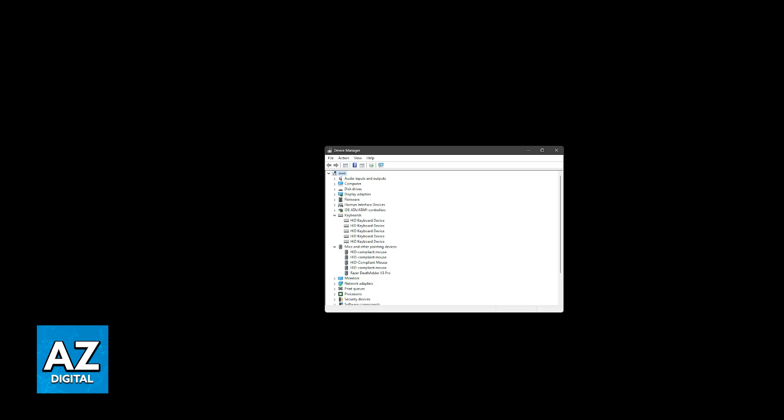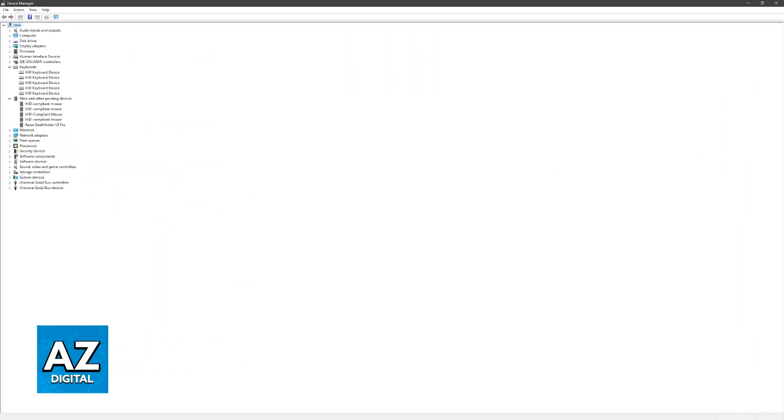The last thing you can try is to enable legacy USB support in the BIOS. In some cases, a setting change in the BIOS might be necessary. To try this, restart your computer and during the startup process — where you see a logo on screen with a blacked-out background — press the key designated to enter the BIOS. This is usually Delete, F2, F10, or Escape. When in doubt, try pressing all of those periodically until you get into the BIOS, which will be a simple interface where you can browse through many options.